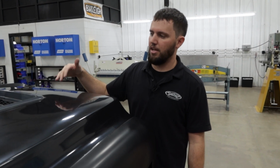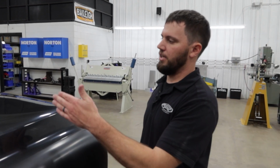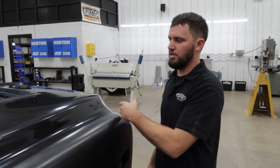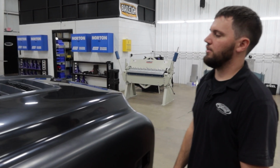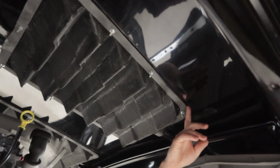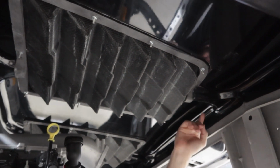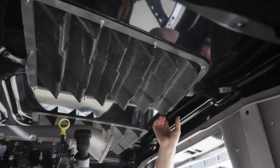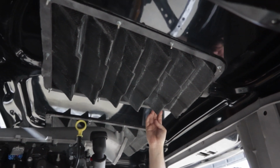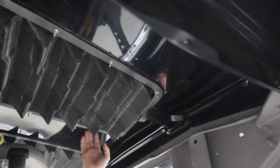Just a street cruiser, kind of unnecessary to have that much ventilation out from under the hood, but it gives us the aesthetic detail and still does evacuate some of the hot air. So you can see they go one more level and finish it out nice underneath. There's a real nice reinforcement flange bonded to the hood. A lot of times guys or companies will put louvers in and just bolt it through just the single wall exterior of the hood.